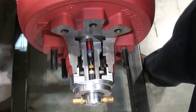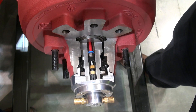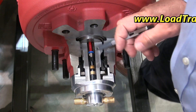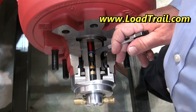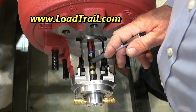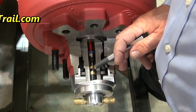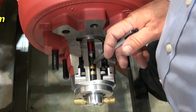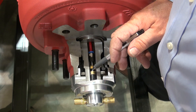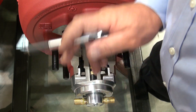Looking at the inside components of this Dexter axle — the air comes through the middle of the axle and through the middle of the spindle. The red tubing comes from the compressor, goes through a push-to-connect, then through a cylinder plug. There's a cutaway that shows the components inside the cylinder: a double-lipped seal and a bushing. The bushing keeps the shiny shaft centered in the seal so it doesn't leak and you get long life. From the cylinder plug, the air goes out to the rotator, and from the rotator out to the tires.